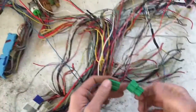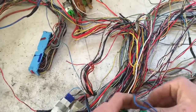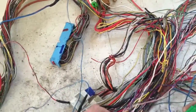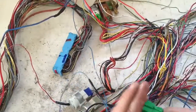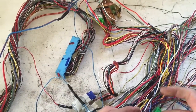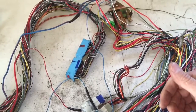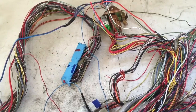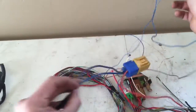So that's all this other side is — just a ground. You can see it ties into this black and red wire, which is just a ground. That's how the test mode operates: click them together, it's now in test mode. Turn the key to ignition on — not start, just ignition on — and you can test your arrangement before your first start just to make sure your fans and fuel pump are all operating correctly. We're going to put this near the ECU.